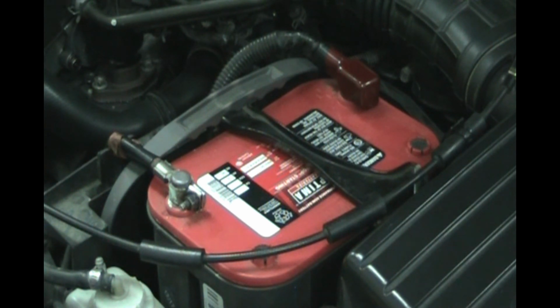Chevys and other cars have a very specific drive cycle of certain speeds to maintain for so many minutes, and then decelerate without touching the brakes, and they're a little harder to reset sometimes. So it's not a big deal if your smog check is a ways out.